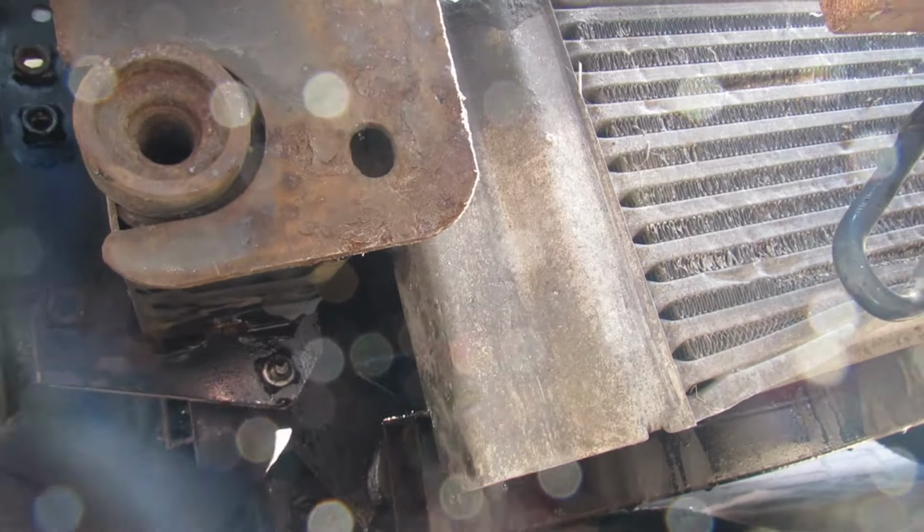A couple of times, I've seen this referred to as burping the cooling system. You had the cap off it, didn't you? Yeah. It did shoot up and you could see some air coming out. Within about 5 or 10 minutes, that fixed the problem and we had heating in the cab. It's supposed to be self-bleeding, so you don't need to do too much, but that was just a way of accelerating the process more than anything.